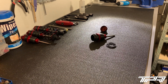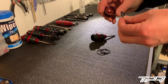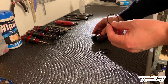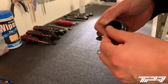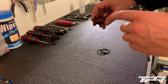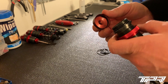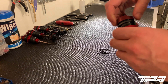After finishing assembling the shocks, I noticed I had four o-rings left - the same size as the o-rings inside the cap. I figured maybe they were spare o-rings, but then I contacted Matthew Olsen of Mod Racing and asked where these are supposed to go. Actually, they go on the outside of the shock body here. I know a lot of you have learned they should go inside - I told you that earlier in the video - but with this construction you actually have one o-ring on the outside of the body and one o-ring inside the cap, making it a really reliable seal in both ends.